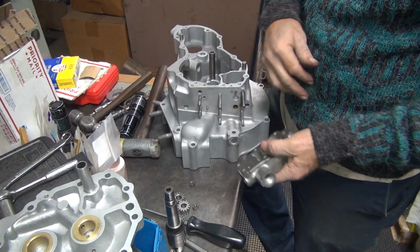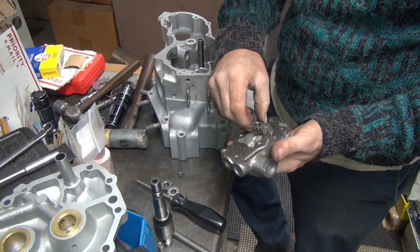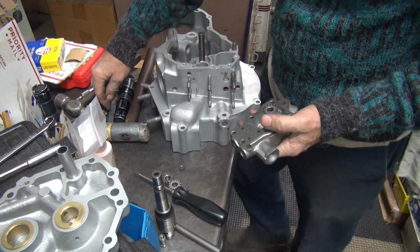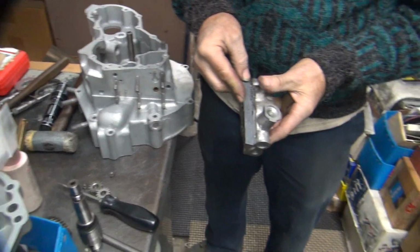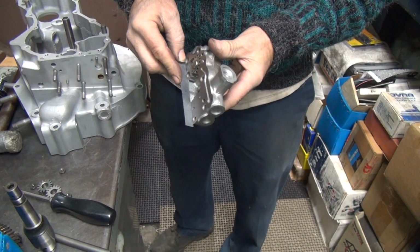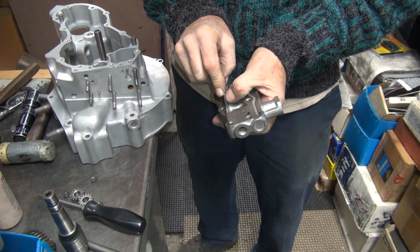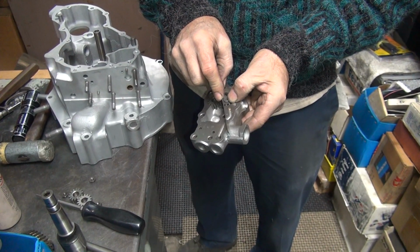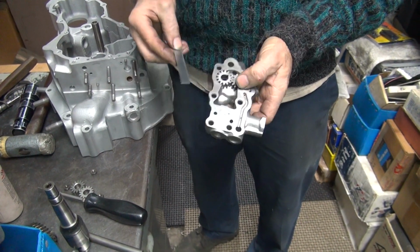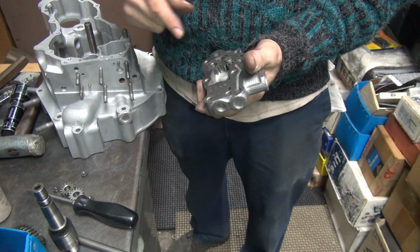I don't know what gasket we're going to be using on this side. So we have our 2 gears here. It's basically flush. That's good. No, that means there's no room for a gasket. The gasket is going to be clearance. So, oh, right. So yeah, this one could use a 2 thou gasket. So we're definitely going to have to use the 5 thou.